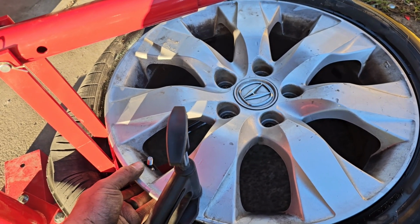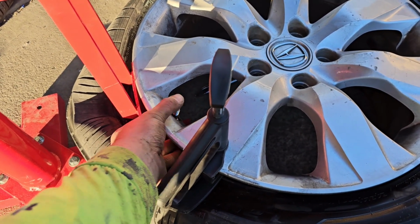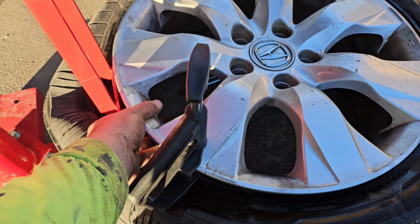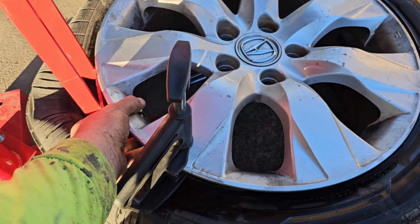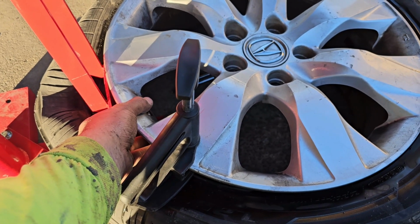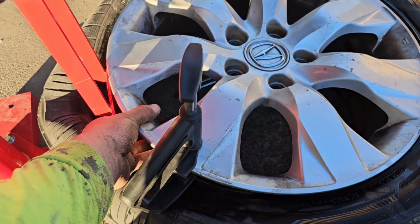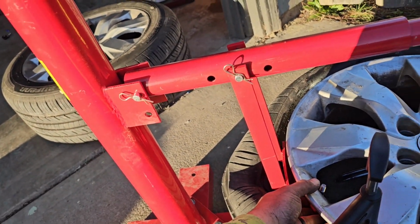So yeah, I mean, that's it for the video, guys. I'll obviously put it on the car and then show you guys how to reset the TPMS. But for right now, they should be pre-programmed, so with a little bit of driving, they should clear themselves if they would work. If they don't work, I heard you have to add pressure and release pressure and add pressure and release pressure, so the sensors quote-unquote wake up. So yeah, that's gonna be a mission. So I'm gonna crank it up to 80 psi, drop it down to 70, drop it down to 60, drop it down to 50, drop it down to 40, crank it back up, and if they don't wake up by then, I'll take it to a shop where they can read the codes with a code scanner, because I am not buying a code scanner, as I was trying not to get into a shop by using this anyway.